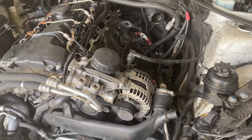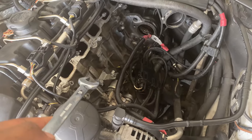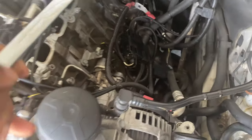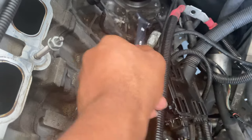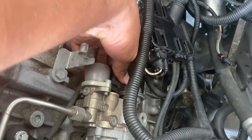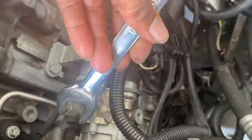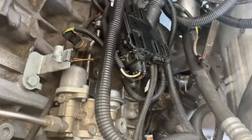New day — only about 30 minutes to work today. I'm going to remove the fuel line from the motor. Normally you could use a special tool and push in right here to take it off, but I don't have that tool and I don't want to break the clip. So I'll use a 17 millimeter. First you have to disconnect the high-pressure fuel pump: push these tabs, pull them out to give more room, then use a 17 and loosen it. Once you loosen it, you can't pull it off yet.